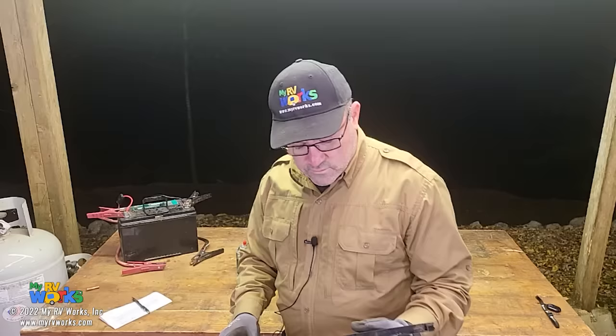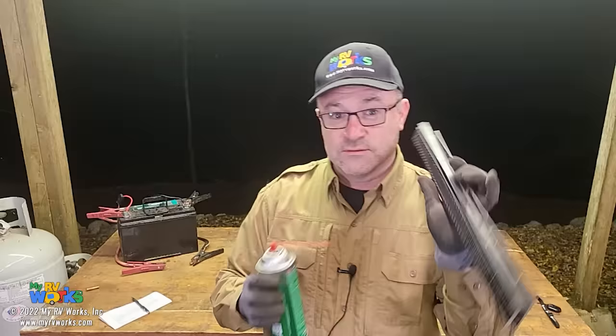So the first thing I'm going to want you to do, and I'm about to say something that Lippert is going to counter. Lippert's going to tell you not to do what I'm about to tell you to do, and there's a big debate on the internet. I've had people talk to me about it, and here's my take. It has to do with lubricating these slides. Lippert's going to say never lubricate these at all under any circumstances, don't put anything in them, and I'm going to say that you should always lubricate these things, but not with just anything. Lubricate it with this product here. I'll make a link down below.